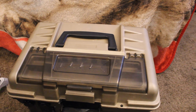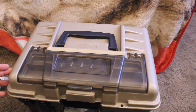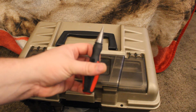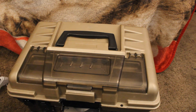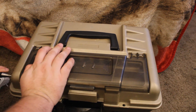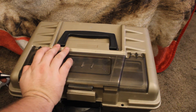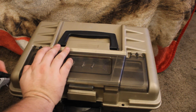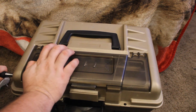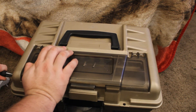Off-camera I did a little bit of wiring. I've got the wires for the lighter plug, USB, and voltmeter ran up from the bottom. That wire is the ground for the battery — the grounds are there where they were before — and that ground wire runs up and will daisy-chain to all the switches, but that's not going to happen in this video. What we're going to do now is put the holes in for the lights. We'll have holes here, here, here, here, here, and here — a total of six lights, two lights on each side.